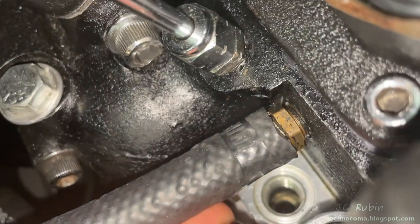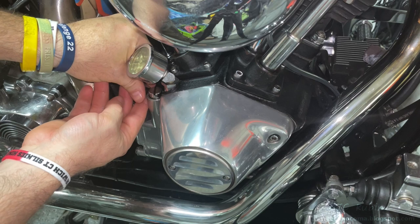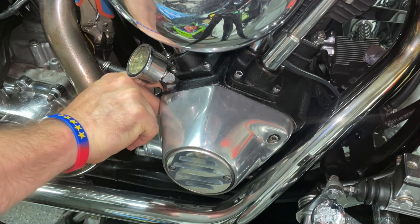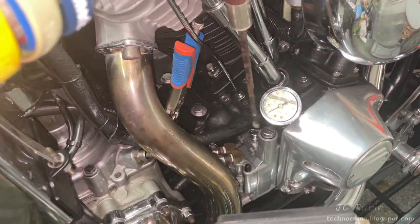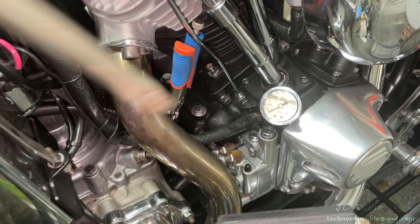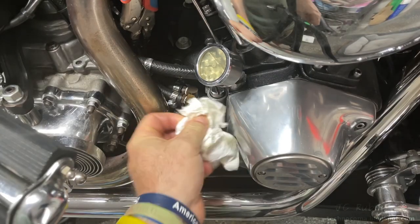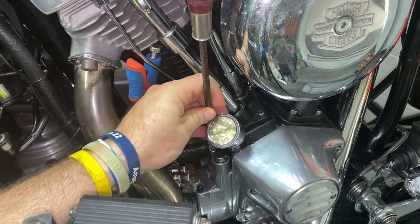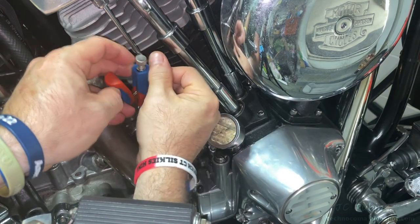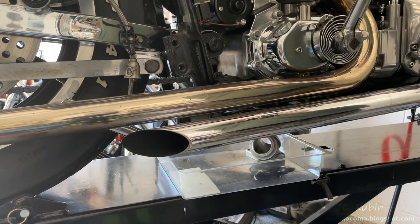Inspecting inside everything seems okay, and now I drop in a fresh bearing and we're ready for the spring and cap. Given the clearance I find it easy to put the spring in the cap first, then drop the spring into the hole, pushing the cap down under that hose and squaring everything off properly — making sure it has a nice bounce to it. Using a long screwdriver to turn that cap back down to full seat, and then with the big fitted screwdriver I snug it down. I clean up, reintroduce and tighten down the hose clamp, and remove the vice grips from the oil line.